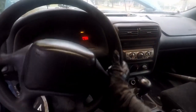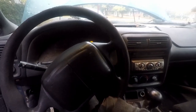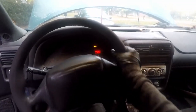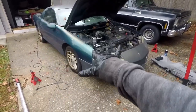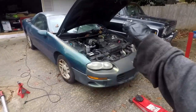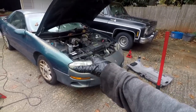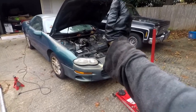To count from lock to lock — let's go all the way to the right. One, two, just over two. So before it was like two and a half, but now it's like two and a quarter — really two and an eighth. It's not much difference at all, but we definitely have a quicker ratio steering box now. Everything seems to be bled and I'll keep an eye on it the next couple days just to double and triple check. I need to replace the tie rod outer ends and I'll do that off camera since it's simple enough. We got the quicker ratio installed — I think it only worked out because this is a 2000; the 97 to 99 you'd have to swap the steering shaft, and definitely the pre-facelift too. I think I just kind of lucked out with this being a 2000 — the 2000 to 2002 models kind of just all shared the V8 parts even though it's a V6 car. Thank you for watching and I'll see you in the next one.